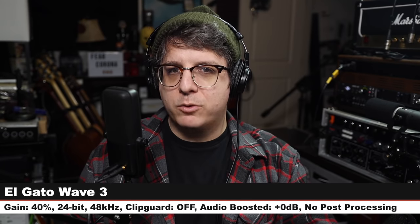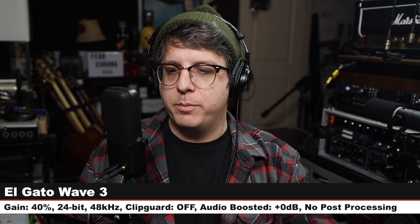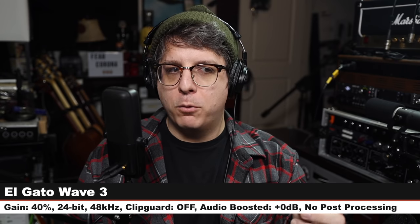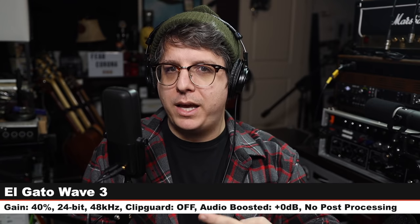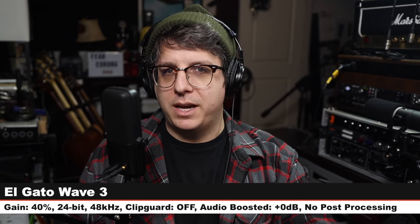Now I want to do a very quick comparison between the Elgato Wave 3 and a bunch of other microphones on the market so you can understand where this fits into the bunch. Like always, we'll start on the Wave 3. I am 6 inches off of this microphone. My gain is set at 40%. I do not have the high pass filter or the clip guard engaged, and here is how the audio sounds.